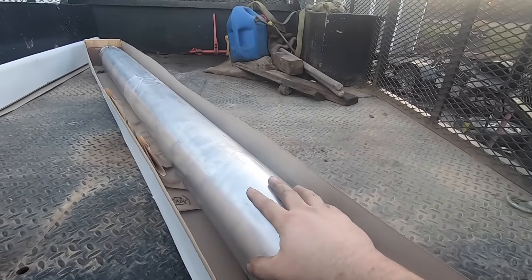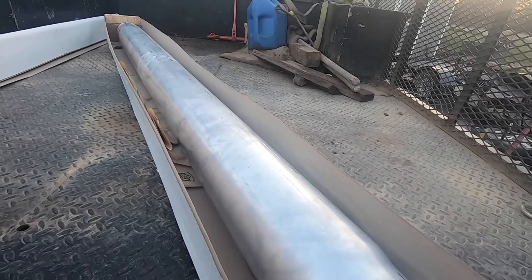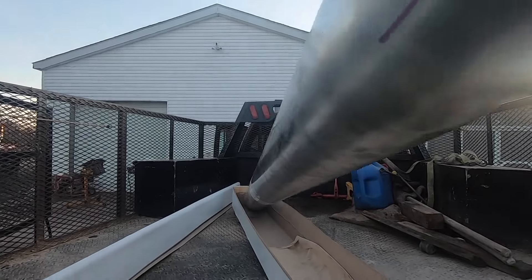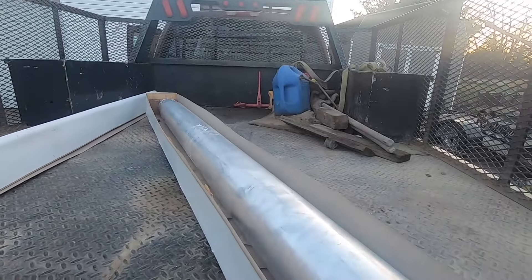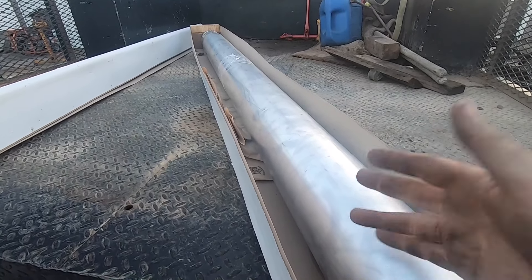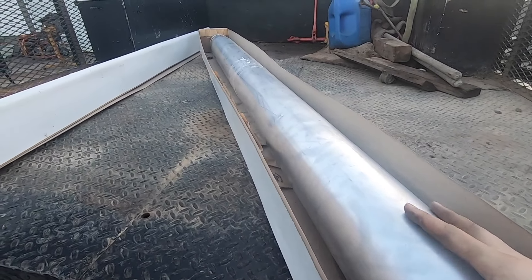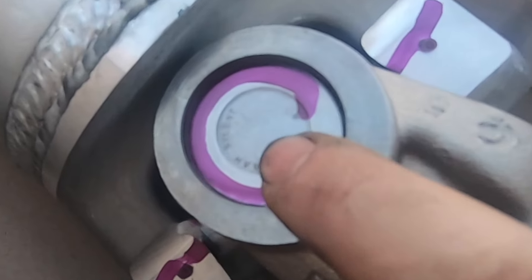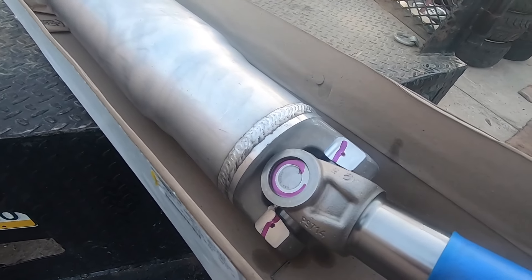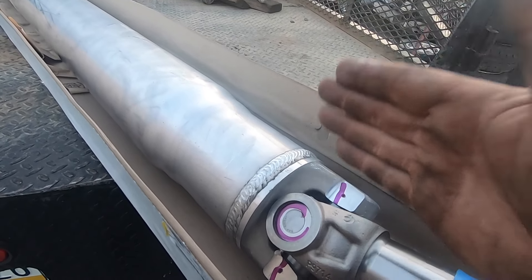There was a lot of hesitation about going with an aluminum shaft when it's this long — is it safe, are we reaching critical speed? GM did the engineering on this. This thing is like six and a half or seven inches in diameter and they put it on brand new trucks. It'll do a hundred miles an hour down the highway and they make more horsepower than I do, so I think it'll hold up. You can see it has AAM joints from the factory — it is an AAM shaft. These are 1485s, direct bolt-in for the stick shift trucks.